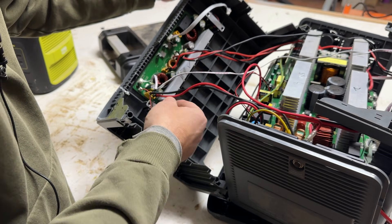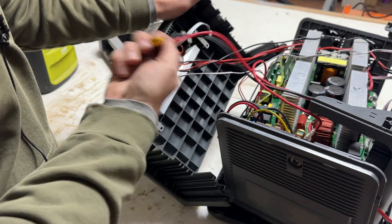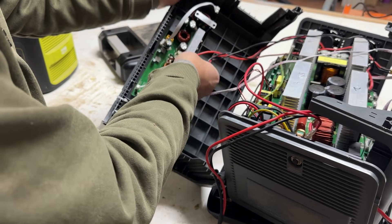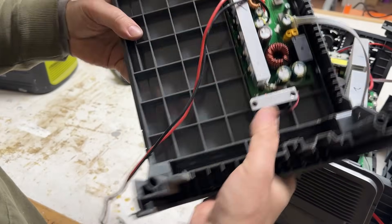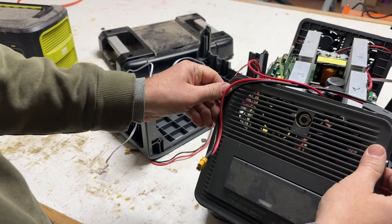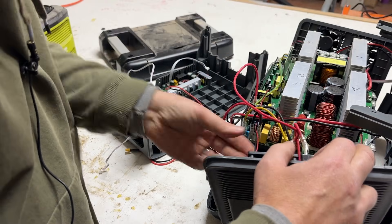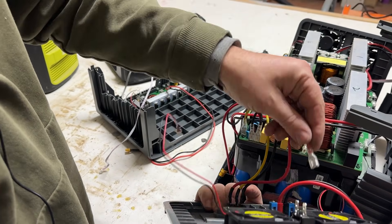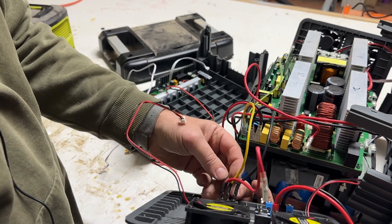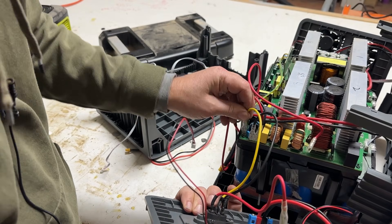This may be a DC input here — it's got a DC output and a DC input. The charging input was there, maybe a 12-volt power supply. There's a little cooling fan, and lots of little parts in here I could save — a couple little cooling fans, one on each side. We've got an overload protector and a little reset here. We've got our AC input here — this is an overload protection for the input, so if it gets too much power coming in, it trips this little breaker. Yellow is ground, red is hot, black is common, going right to our main circuit board.